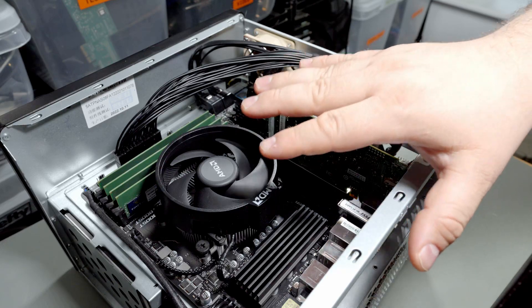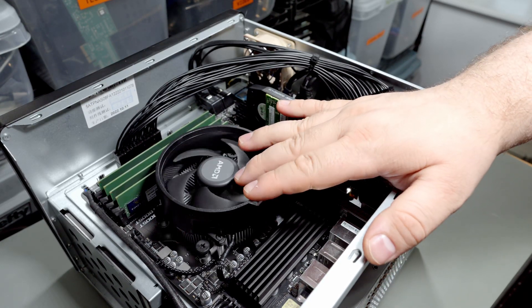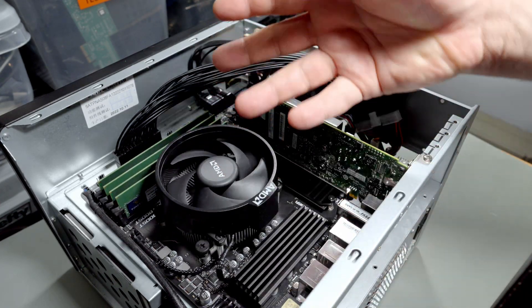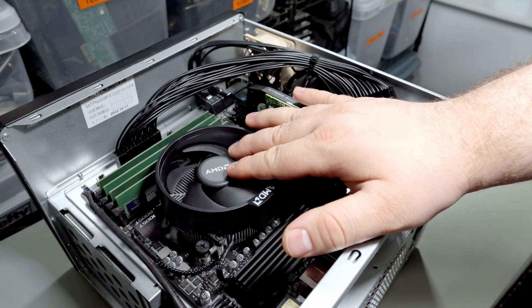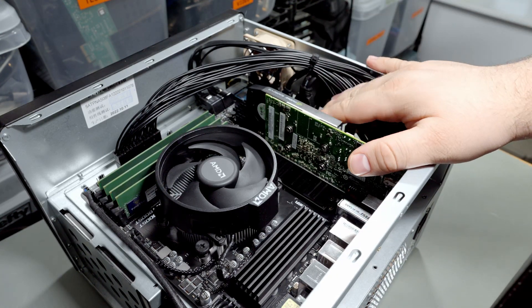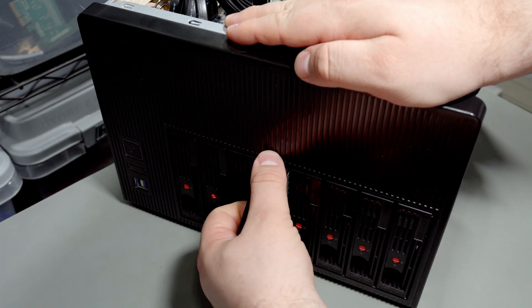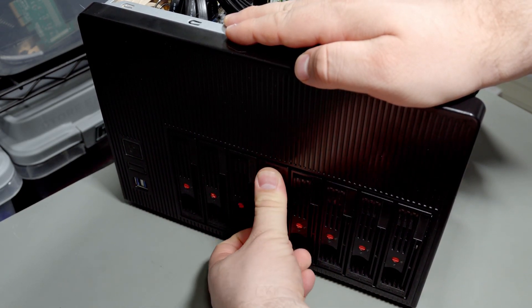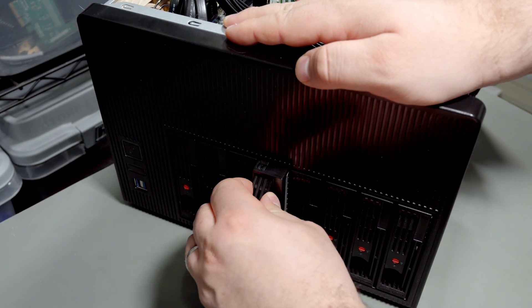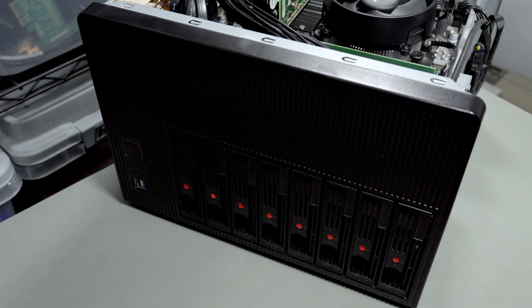If you can get the UNAS version, go for it. Overall I'd give this case a loose recommendation — it's fine if you don't mind faster fans. If you're trying to make a really quiet NAS, you don't want this. The issue is cooling and it really does need faster 92mm fans; I don't think even good quiet fans like Noctua's are enough to keep the drives cool to an acceptable level. Also, these drive sleds tend to catch and are just finicky. They're already very restrictive and have a tendency to catch on stuff as you eject them. They do work, but not great — you can tell it's very cost-reduced.